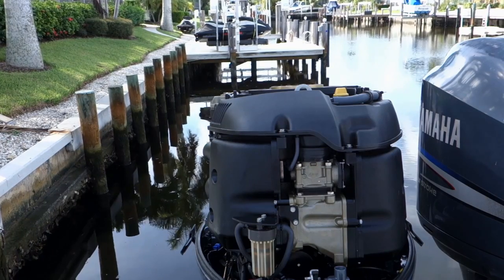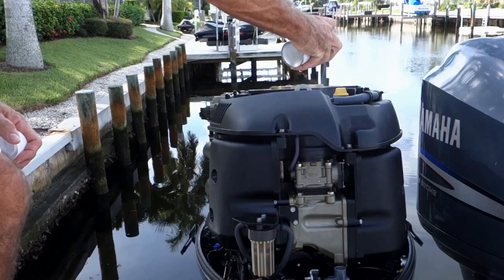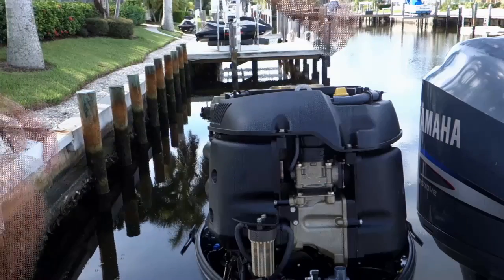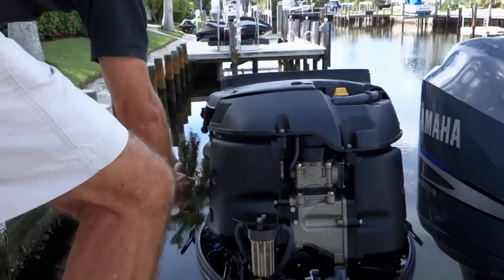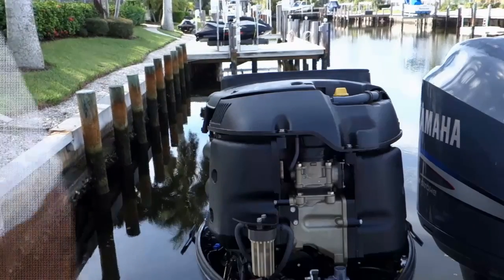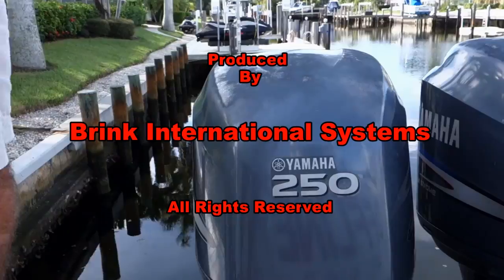That's quite sufficient — very good. Now we'll finish up with reinstalling the flywheel cover and the engine cover itself. I always like to do a little anti-corrosion protection on everything except the fan belts — concentrate mostly on the electrical connections. Always good in this saltwater environment. The flywheel cover once again just goes on with its little fancy rubber attachment points, just press into place. Give those engine cover holding points a little anti-corrosion protection as well, then install the cover, lock it down. That's it — let's go boating.